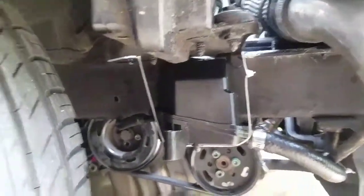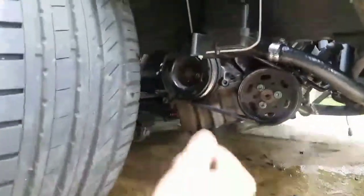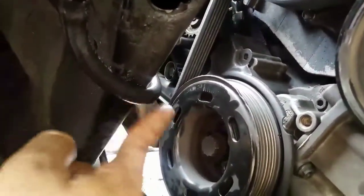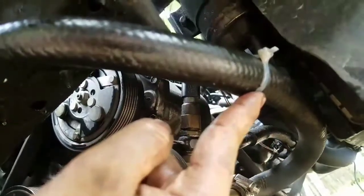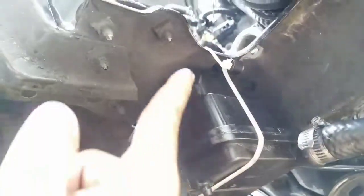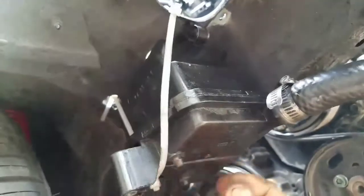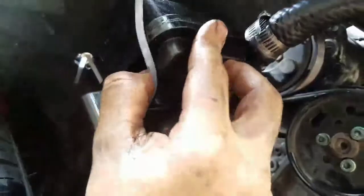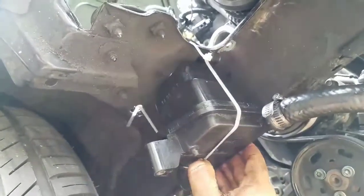It's not that hard. You see that one is not gonna be touching anything — the bumper is gonna go in right, it's not gonna be touching any of the pulleys. That's why I only used less than one foot of hose — remember, it's half an inch. Then I secure the hose with a zip tie here. As you can see, this is not going anywhere.